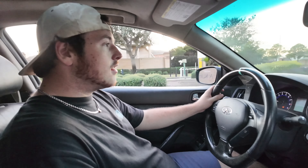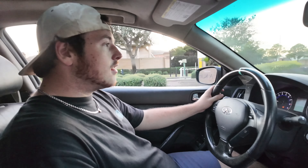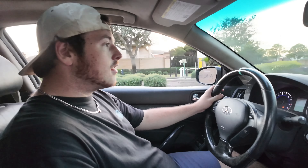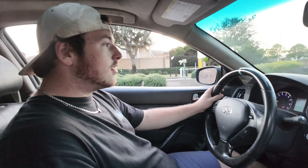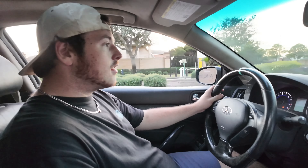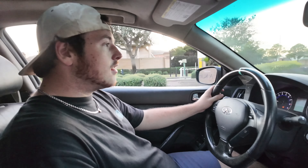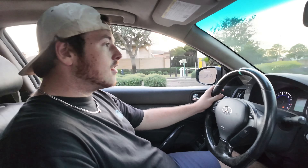For this section we do have one bolt and one nut that we'll be putting here after we take the cover off, and then we can go ahead and strap that up in the muffler hanger. First, we're going to put our hanger in that little hole up there. I went ahead and put the gasket, ran the bolt through — all I've got to do is add the nuts on each side and tighten it up. Ladies and gentlemen, after final installation, the exhaust is officially on.